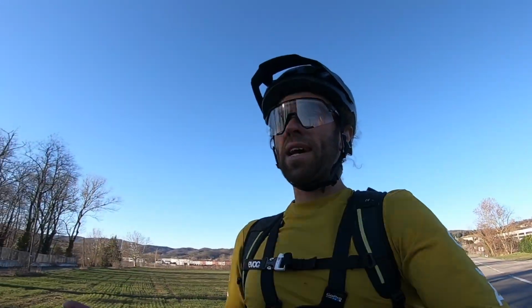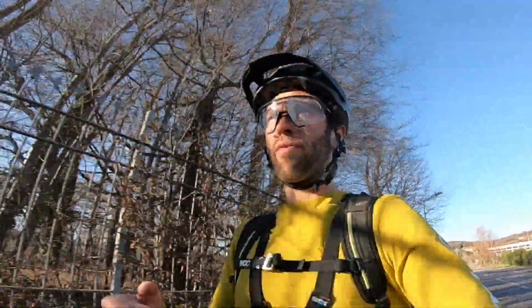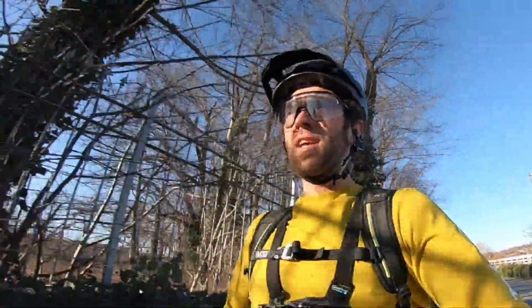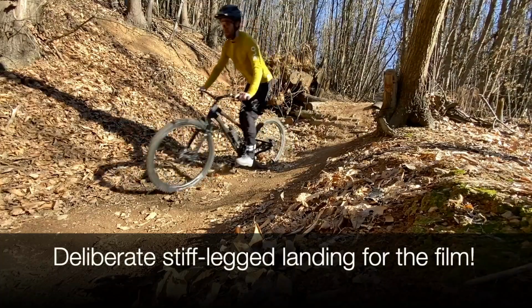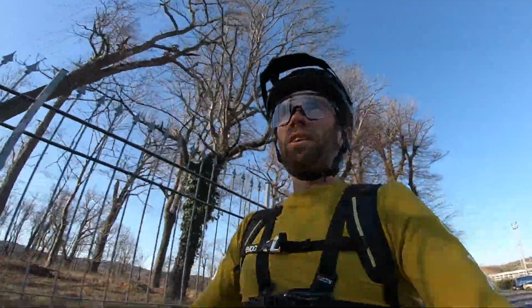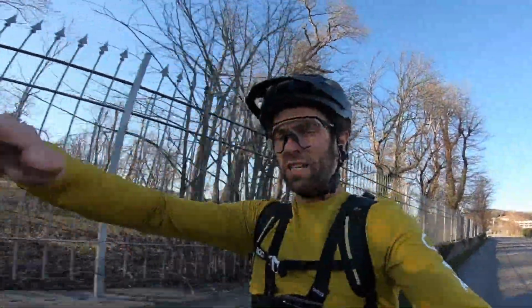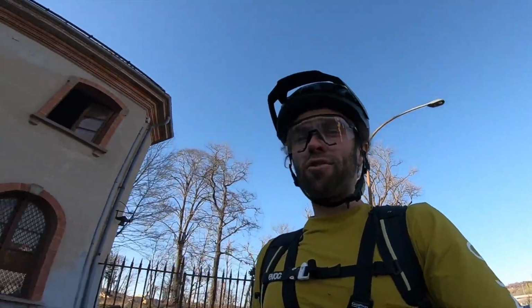So yeah, the front wheel's out in front of us, tons of damping on the fork. This helps to keep the front end up and maintain the head angle, which is what you want. You don't want your front end diving, under braking, down steep stuff, or any time really. You just want the wheel to go through the travel and come back out of the travel. Ideally, in an ideal world, your chassis is just stable all the time and the wheels are moving. So yeah, everything about the front end is really good.